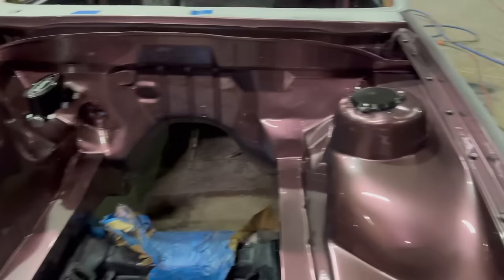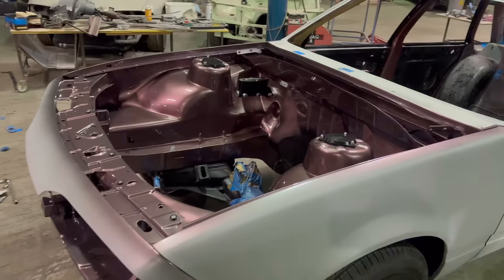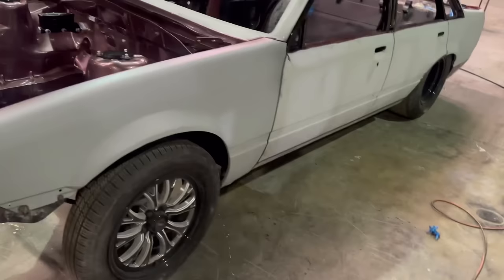Anyway, so I've left the runs and stuff in the bay. There's a few little runs around the place. Everything I can still get to, I'll give a little bit of a wet sand and razz up before I chuck the running gear back in it. Also put the overflow back in, the fuel fitting. So a few bits and pieces done. Very happy. So last thing I got to do is chuck the bottom guard bolts in and we'll be on.